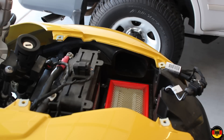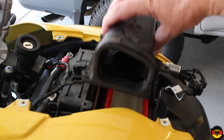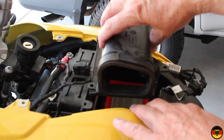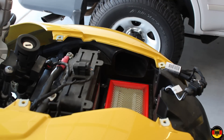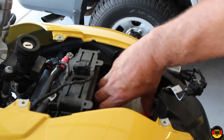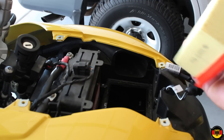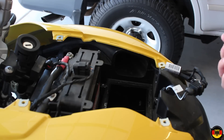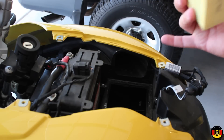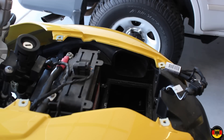The airbox goes right here. I pulled it out and it looks like this. To get it out you have to pull slightly on the side pieces to get it up and out. I'm going to clean it up with some soap and water and Armor All the seals on it. The filter is down in here — you just take it out. Mine is spotlessly clean after 6,000 miles, which is pretty good. I'll clean up this area, put it back in, put the housing back on, and give you the torque settings.